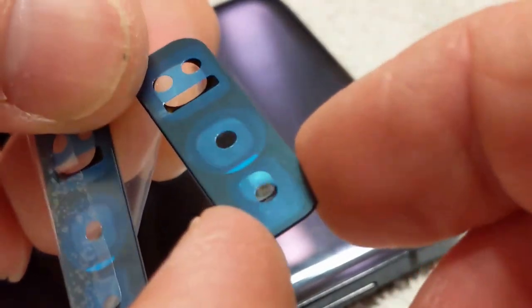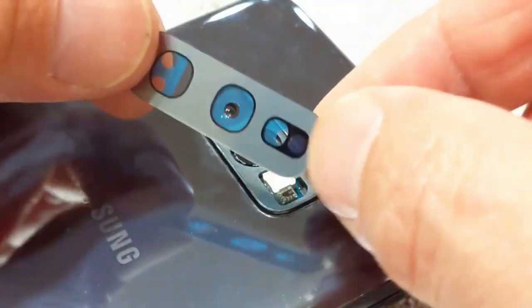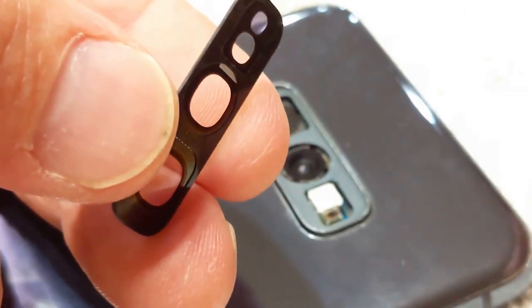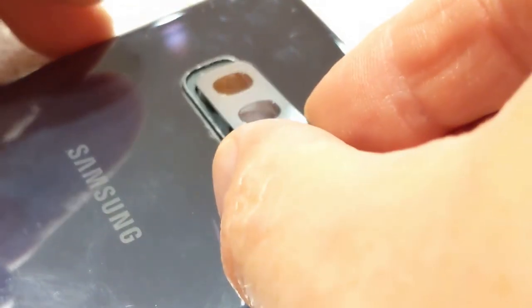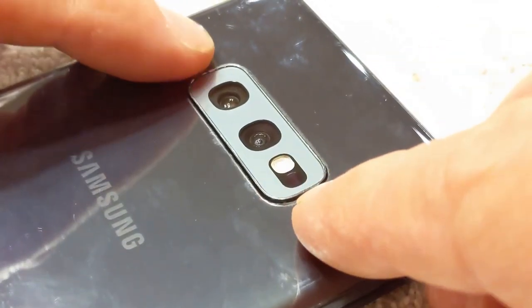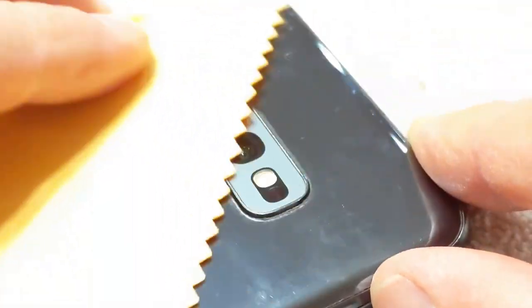The side you're exposing now is the part that will face outward from the phone, so you don't need to be too worried about getting fingerprints on it. Line it up and make sure it's oriented correctly. This kit has cover glass with the adhesive already on it, so we'll apply it like a sticker. Carefully remove the backing and don't touch the sticky part. Fit the glass into the groove — it's perfectly sized, so you don't need to worry much about getting it lined up perfectly. Press it into place with the microfiber cloth and clean off any residue.